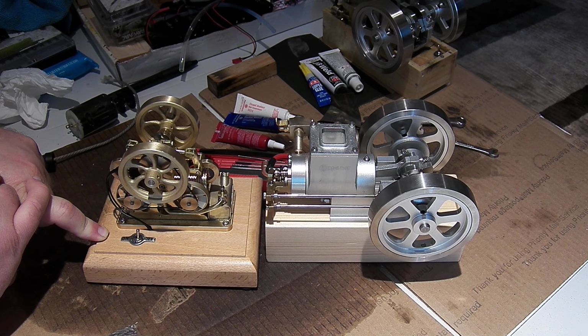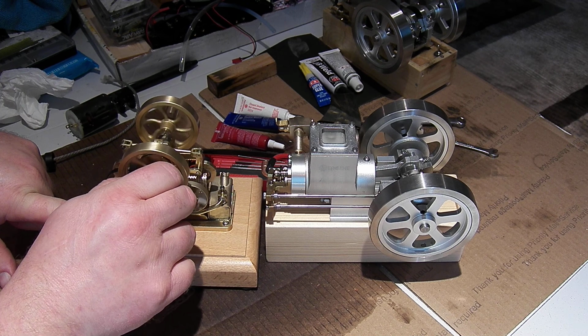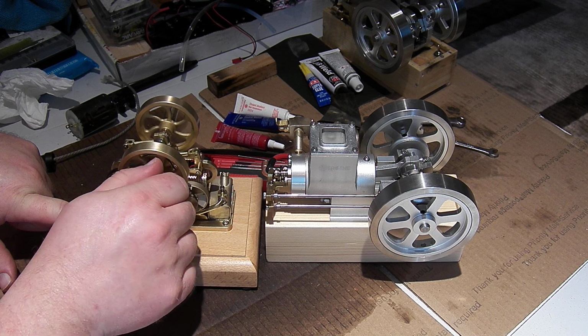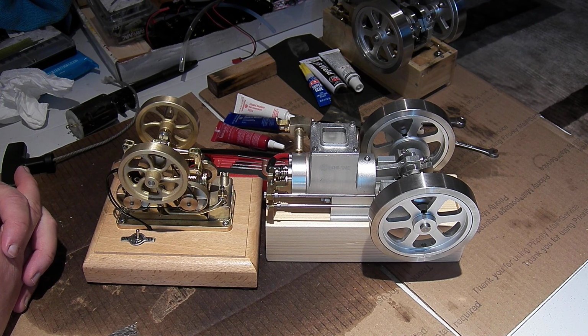It is 10 Fahrenheit out, 12 Fahrenheit out, which is still, you know, almost minus 20 Canadian. And that's cold enough that even regular engines can have trouble starting. Carbureted engines definitely have issues in cold this deep. And these little engines are always a bit harder to start than a full-size engine, just because they tend to be a bunch testier. So I'm not surprised I had so much trouble.